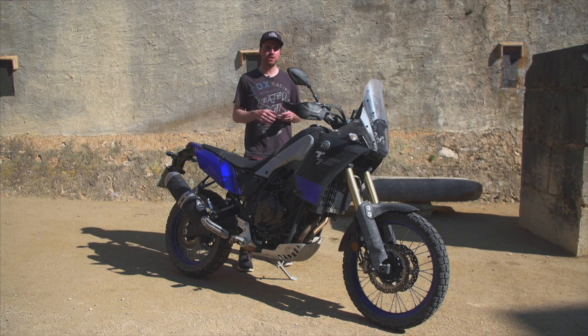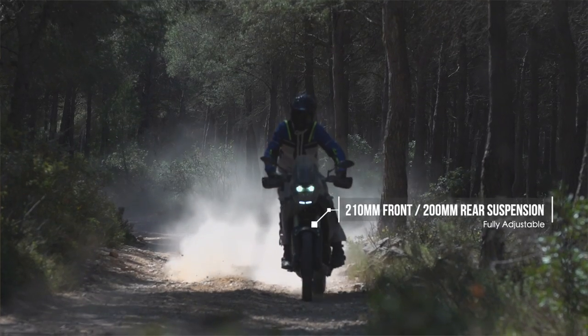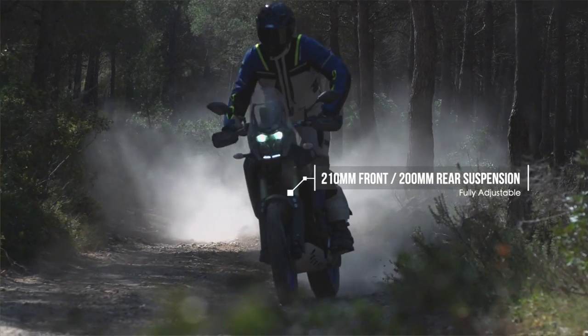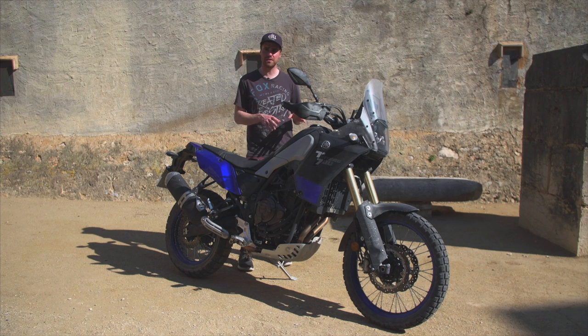The other negative characteristic in the suspension off-road is that the shock did, if you caught it off-guard, bottom out. If you hit a bump you didn't see that was quite big, or had a little jump off something, it would blow through the stroke and go metal to metal pretty quickly. There's better bottoming resistance in there than on a lot of other bikes — and especially compared to the older Teneres, the 660 and so on, it's infinitely better — but it could still be better again.